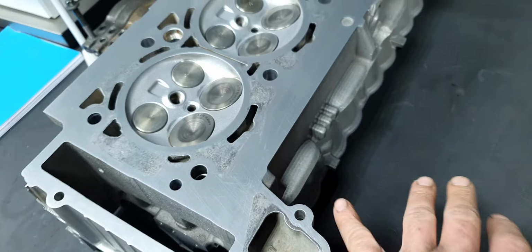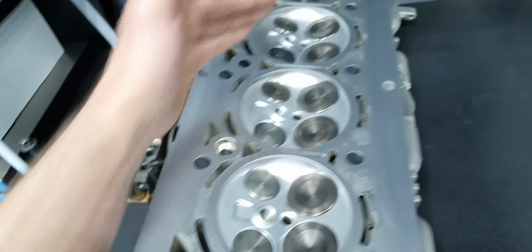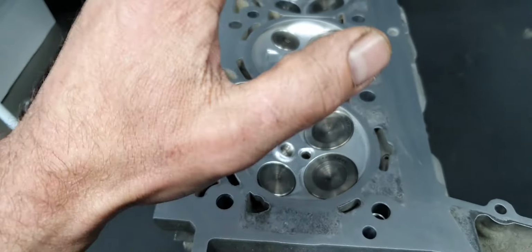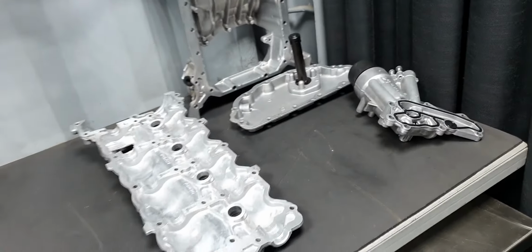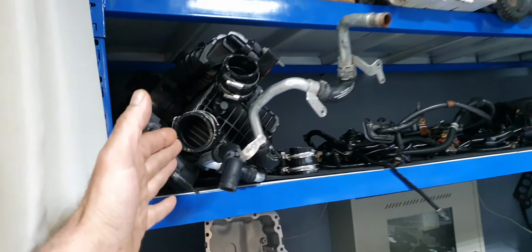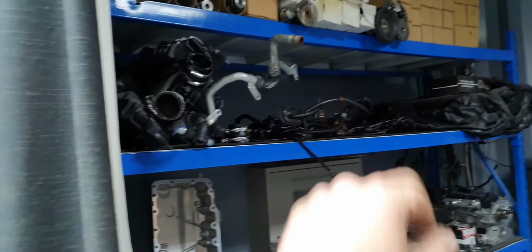It looks okay. Plus, like I said, I put petrol here. I don't see any leak from the valves, in none of the valves. The same thing from the exhaust. And the valve seals are new on this one. On the other one, it's not new. It's tired. And if I judge from the color of the oil inside, it's not ideal. So now, here I put the intake manifold and the wiring harness. The wiring harness has been prepared by Mr. Ayub. He's doing a good job, with spray contact cleaner, one by one the plugs, blowing with air to be perfect.